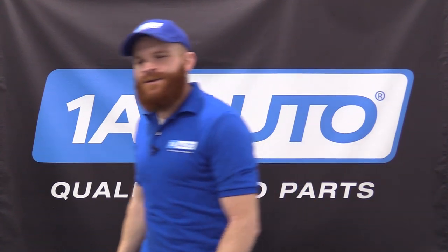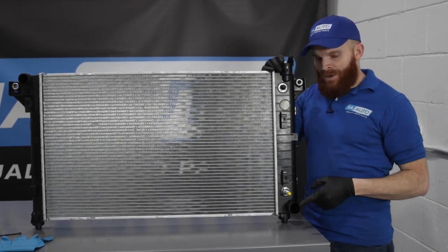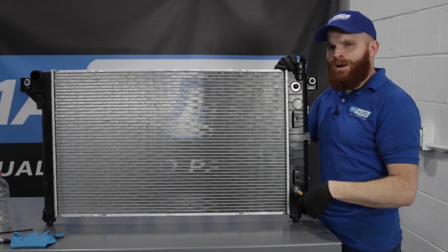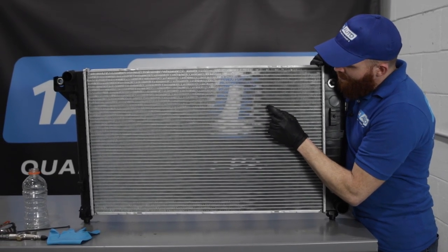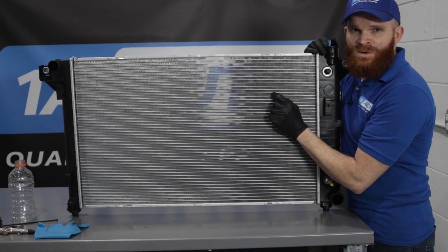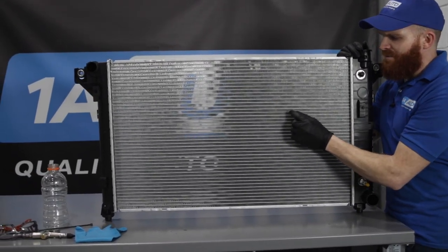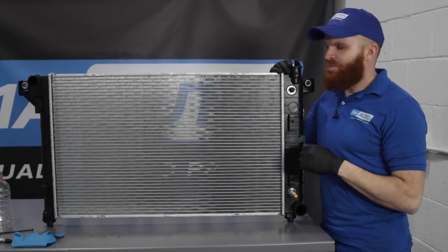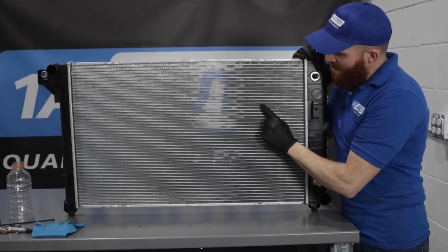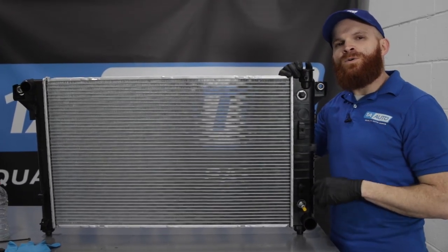The radiator is basically just a fluid-air heat exchanger. Coolant is going to go in through your radiator right through these hoses — there's one up top and one down bottom. It comes through and gets forced by all these little fins. There are little tubes that go side to side, and on those tubes you're going to see these little fins, and the fins are where the air goes through. This radiator is primarily going to be made out of aluminum. All these fins are very delicate — you don't want to touch them and push them over. Aluminum is used because it's lightweight and it's also great at dissipating and transferring heat. Basically, you've got the heat of the coolant going through all these little tubes, and the fins are going to let the cool air from outside your vehicle get pulled through and cool down that coolant, which also cools down your engine.